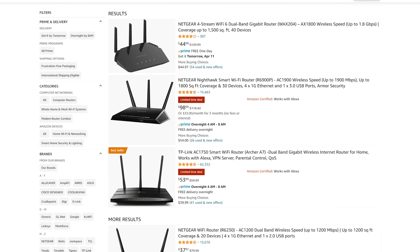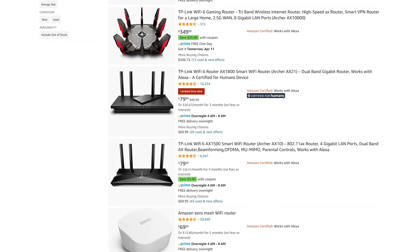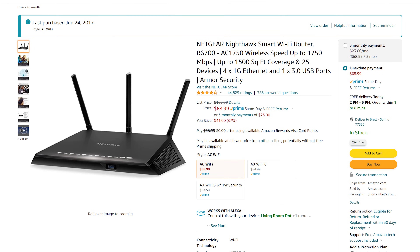That's been a test of the three different Wi-Fi configurations, and honestly I don't think there's a real winner or loser here. Each one comes with a different use case. For regular users who just want a standard Wi-Fi setup and don't need the fastest speeds or cutting edge technology like beamforming and Wi-Fi 6E, any modern Wi-Fi 5 or wireless AC router/access point combo will probably be fine. This old combo is still functioning perfectly adequate for a modern system — you'll save money and probably not even notice the difference in speed versus a higher-end system.